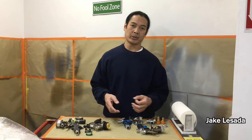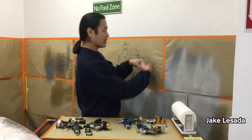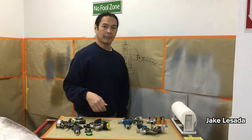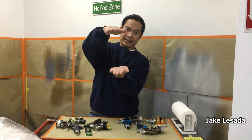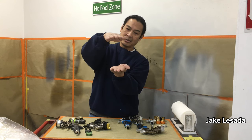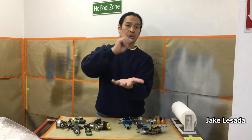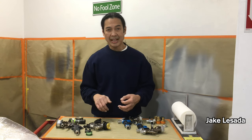If you know what type of paint you're using and how thick or thin it is — let's say you're coming from the air compressor side, used to mixing up and adding a bunch of reducers so it's glassy and smooth — with turbine spraying I don't like to over-reduce. I don't want to use any reducers because when you spray a layer with a lot of reducers, it's going to shrink down as the solvents evaporate.